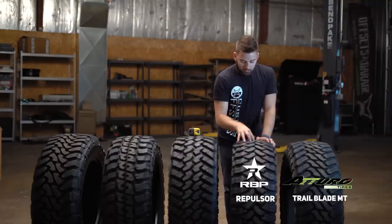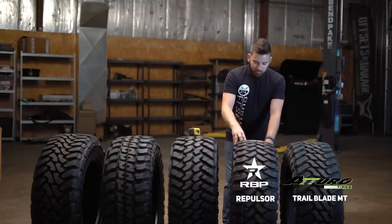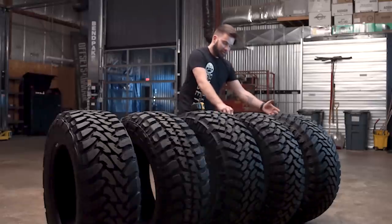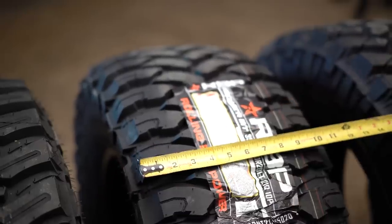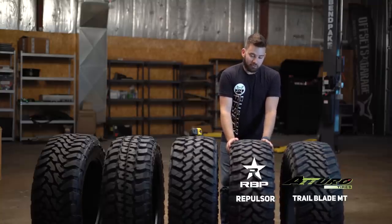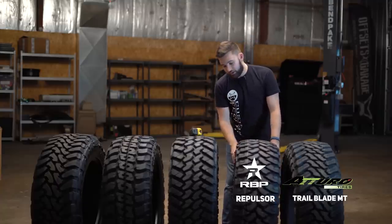If you're running these through anything deep, you can definitely make it out just fine. These are also a relatively good price point — $1,050 for a set of four. Load range E, 121 load index. As far as tread depth goes, this is 16/32nds, whereas the Trail Blade MT is 20/32nds, so it's not quite as deep — a little less rubber. Also, when I measured seam to seam, it's only about 11½ inches, maybe 11¾. They do give you a slightly narrower tire, which isn't always a bad thing if you're trying to fit 35s on a 6-inch lifted Chevy — a little easier to fit, or if you're going for that stretch look.